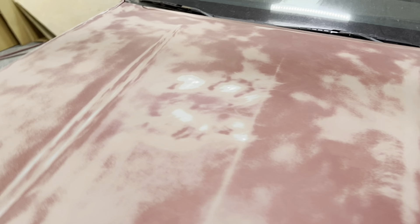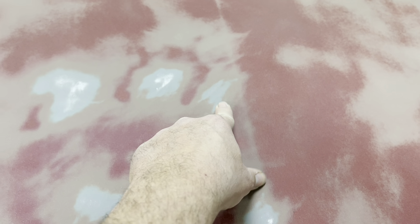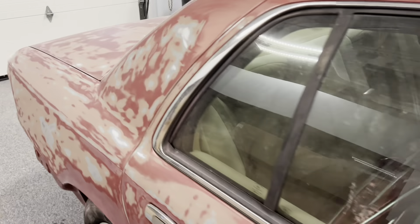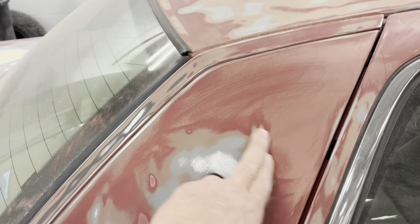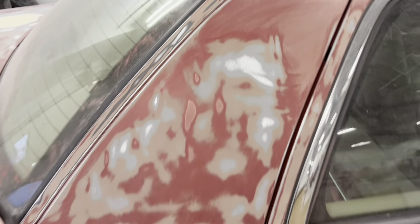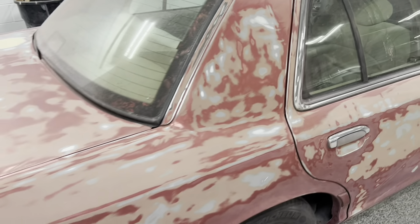Those of you who have paid any attention to this project — when you have students working on stuff, like these spots, that will show up. But we're going to put several coats of primer and we're going to have it blocked out. That's from them standing a DA up on its edge. There's some more of them here. That'll show up, but after we prime it we'll put a guide coat on it and block it. And it should look nice.